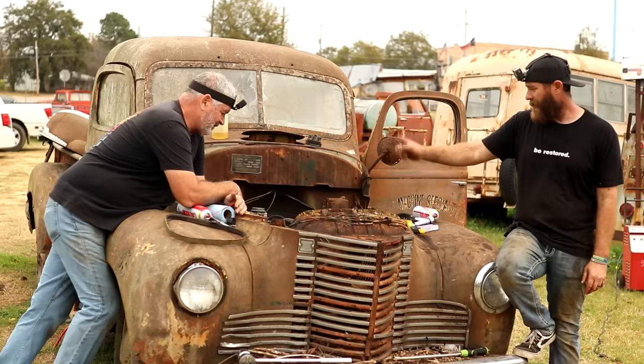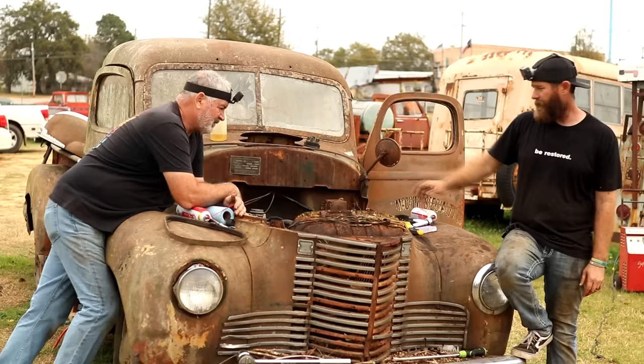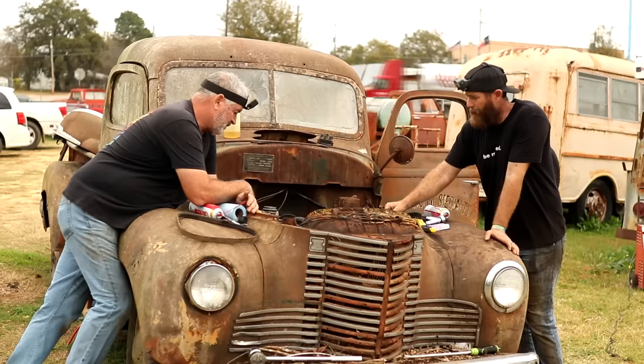Well, over the last little bit, things haven't progressed too well. We left off with pulling the carburetor off to clean it. Once we got it pulled off, we found out that it was completely flooded in that intake there. It was just holding gas. So Dad got the carburetor all pulled apart, got it cleaned up, and everything seems to be pumping the way it needs to. But now that we've got it all put back together, we have fought this starter.